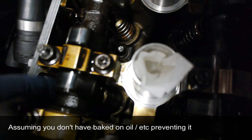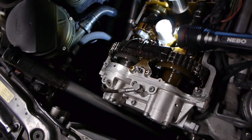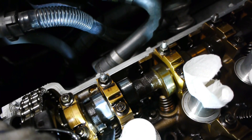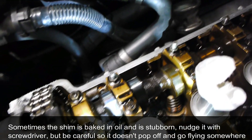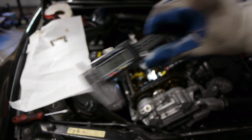Sliding the rocker arm is usually pretty straightforward — you can try from the shaft side. That is the rocker arm moved off. Now I take the magnetic tool and pick up the shim, pulling kind of straight up. Sometimes it doesn't want to come out — you try to clip it a few times and then it pops up. Now I'm going to measure the thickness of this shim. It looks like it's a 2.24 shim, so I'll go put that into my spreadsheet.